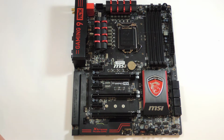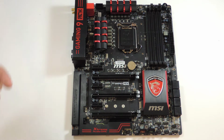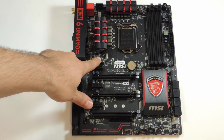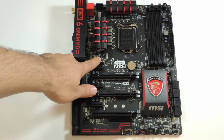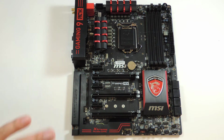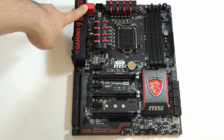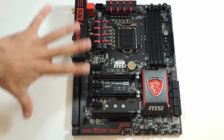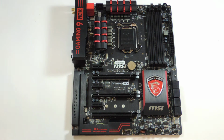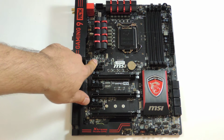So if you're in a room with wired and wireless, you don't have to just give up the idea of wireless altogether. What Killer Doubleshot allows you to do is basically program it so that all the gaming stuff will go through your fastest NIC, your wired NIC. Everything, such as Windows updates, used to be throttled when you used Killer through the software. No more do you have to throttle that anymore. All that can just be shifted into the wireless NIC. So the wireless NIC will handle all your other traffic.